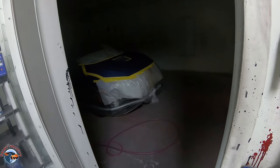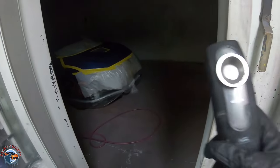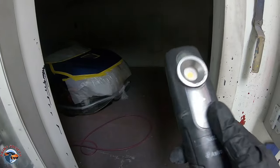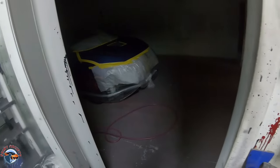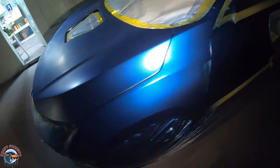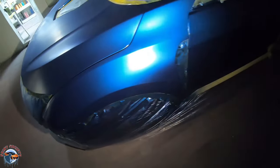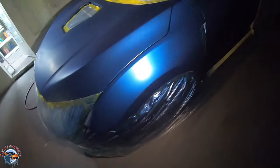We're going to check coverage with the lights off. We can use the 3M sun gun or the Astro - the Astro is also a very cheap alternative that works really well. We check to make sure we don't have any areas that are light that we missed, and to see how our blend is looking. It looks really good. At this point I want to throw on one last coat that's over-reduced. That's going to really help with my metallics because it's got some metallic in it, and I want my metallics to ease into the rest of the paint and not stand up.